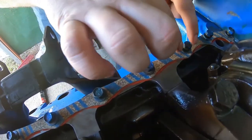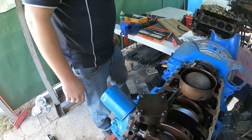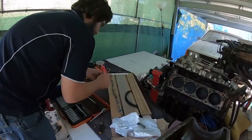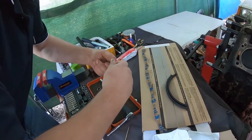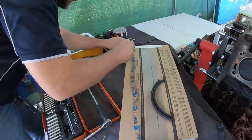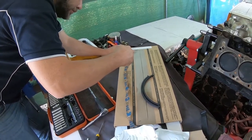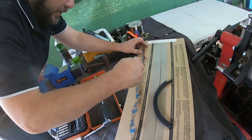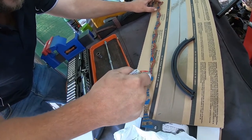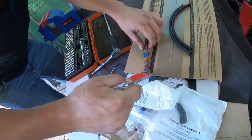Check it, check it. Just holding it lined up, get the other gasket off quickly, spin it, run it in. My pro tip: always keep your tubes rolled up from the bottom — it just makes it so much easier. I'm going with the silicone bead on the inside of the oil pan so it's a bit neater — it will squirm out everywhere, but you don't want it real messy on the outside of the block if you can avoid it.